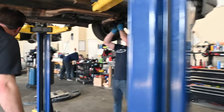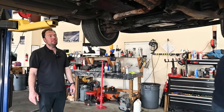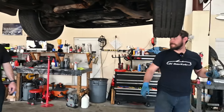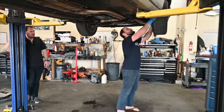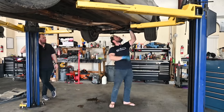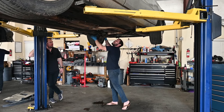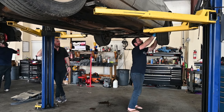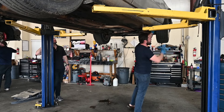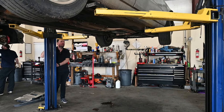They put the heat shield back on and continue assembly. The car will go down the road, though it needs a steering shock. They check the repair — it's better, but it still needs other arm bushings and a couple of tie rods too. The goal was just to make sure it didn't fall apart, and they declare it 'safe-ish' because it was pretty bad before.